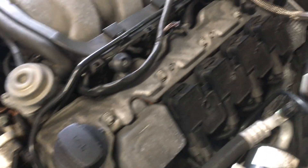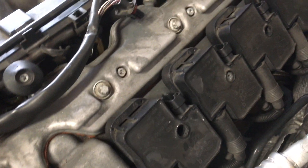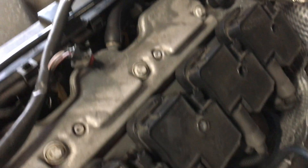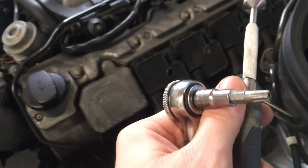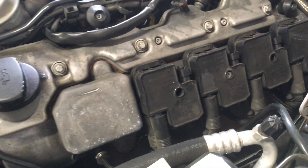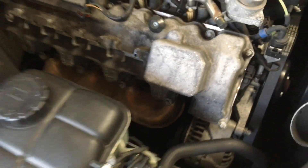It's still not cool enough to work all the way but I'm getting started. First thing you want to do is unclip all of the individual coil pack connectors. Many times these are going to have broken tabs but if not they just have a little press-back tab and you pull them straight up - they come off pretty easy. Then the next thing is use a T30 and get the little bolts out on each one of them, and then we'll go from there. All right, so we've got one side of the coil packs off.